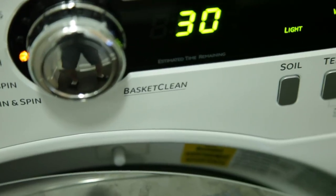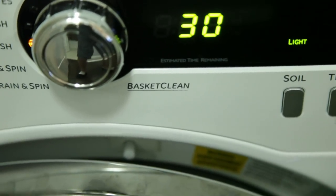Just like anything else in your home, these appliances need TLC on a regular basis in order to work well. One of the things that a lot of appliance companies have been doing is including something like a tub clean cycle. So any time you want to, if you feel like your machine hasn't been cleaned in a while or you did a particularly gross load, you can simply run one of these cycles to clean your machine. You might not need a tablet to do this, or you might. If you do need a tablet, you can pick those up at the grocery store and just run the hottest possible cycle you can with no clothing in the machine. How frequently you should do this depends on how frequently you're doing laundry. You'll notice when your machine gets a little smelly or you see some dirt in there — that's probably a great indication to run one of these cycles.